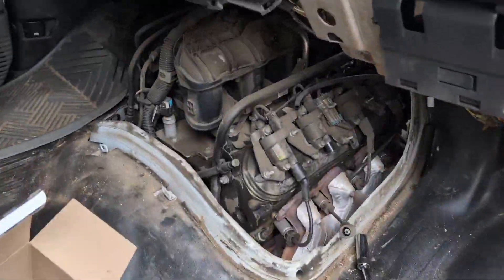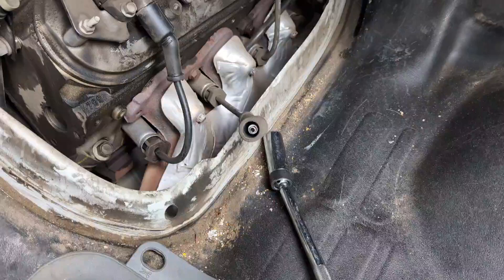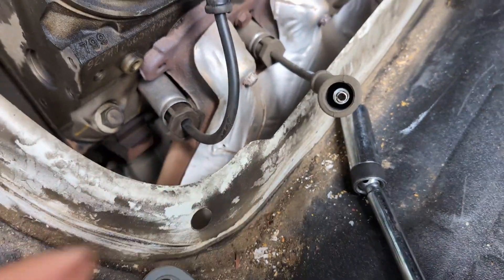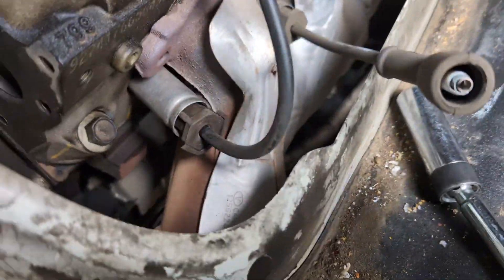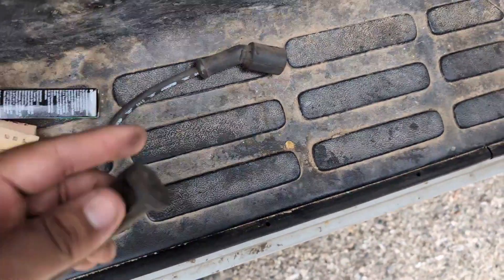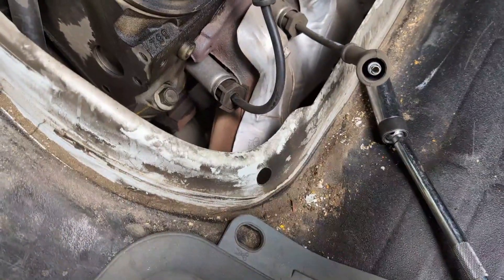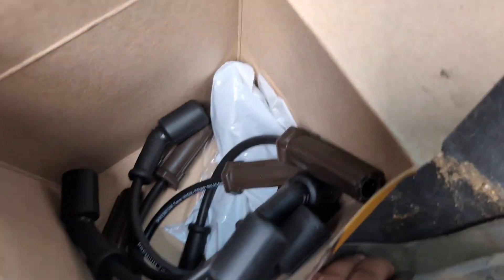Now I'm going to finish unplugging these four wires and changing them, putting new spark plugs in. These come with protective shields so you don't want to pry them — you just want to pull on the boot, because you don't want to damage the metal protective sleeve. Mine ripped on the first one. You can tell these wires are old. Just get some vice grips or pliers on the edge, twist and pull and it should come off — usually with the protective sleeve attached. Then separate them and find the same size wire.